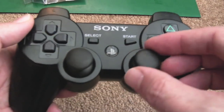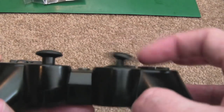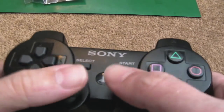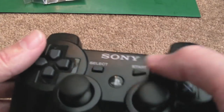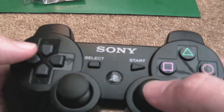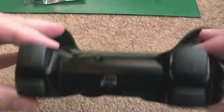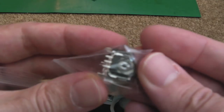After reassembling with new caps, you can still see the stick doesn't self-centre quite properly — that's the worn spring inside. The oil did solve the sticking problem though, and the start button contact cleaning with IPA worked — no problems at all. The controller works well, but I will swap out the sticks. I've got the correct three-pin replacement sticks now — you can see they've got three contacts on each potentiometer. I'll warm up the soldering iron and clean the tip.